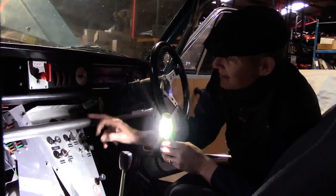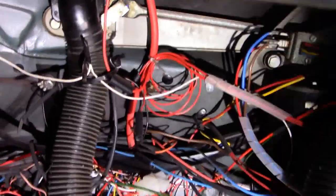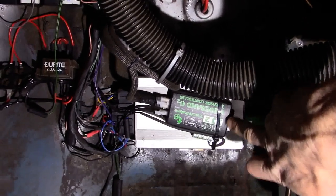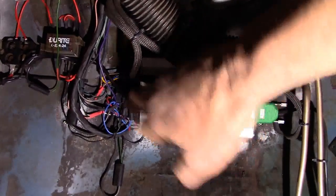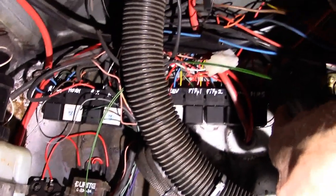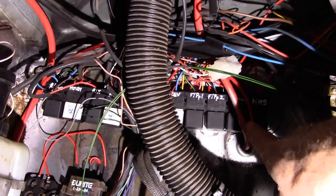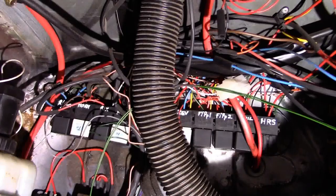In competition the lambda feedback isn't used, so we just switch it off. That bracket needs to be fixed since the new cage has gone in. On top here is the lambda controller before it goes into the ECU. Underneath is the Emerald ECU - there's its programming port and its input/outputs. Below that is the fuse box for all the fuel injection, and up here are the relays for things like injector power and fuel pump power.